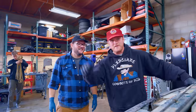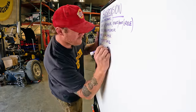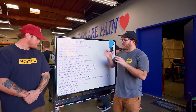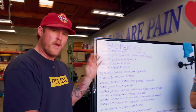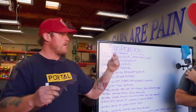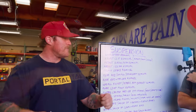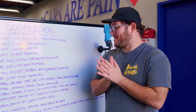This is Dylan. He's going to be helping us out on this build. He knows a lot more about these trucks than we do. Dylan was kind enough to put a whole list of tasks together for us. What are going to be our biggest challenges? Front beams and front radius arms. For the front end, we have to find our caster, then locate everything we want — it's going to take a lot of trial and error. We need full bump, full droop, full centers. Lots of fabrication.